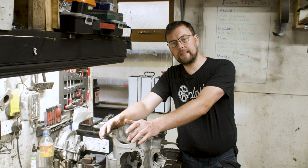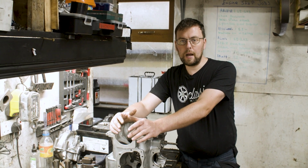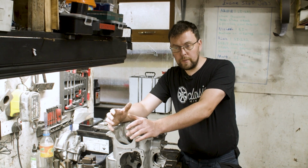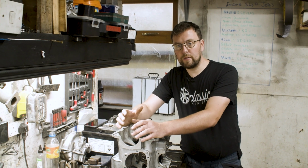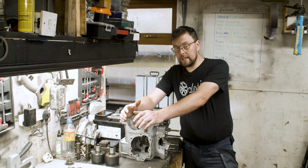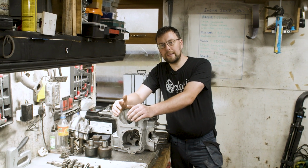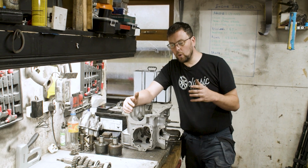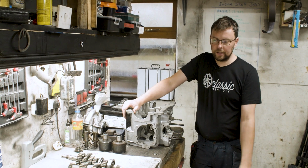Therefore being able to make the gear itself stronger. So the weaknesses that are apparent as a result of the machining process are greatly outweighed by the strength of material that we can use. Also, because they are very easy to machine, they can be made in great numbers and we can get very much different ratios easily.